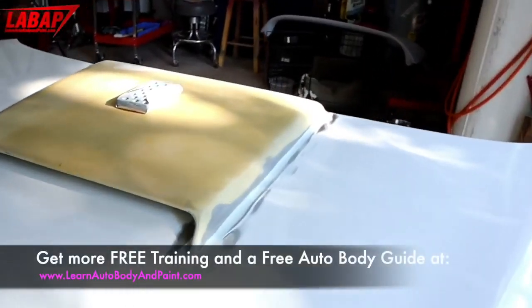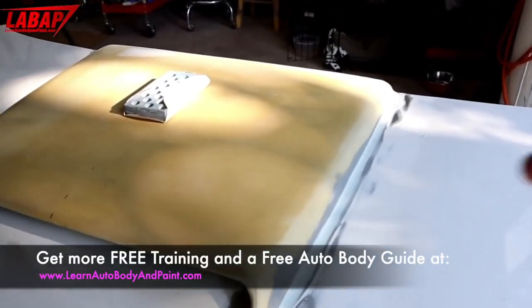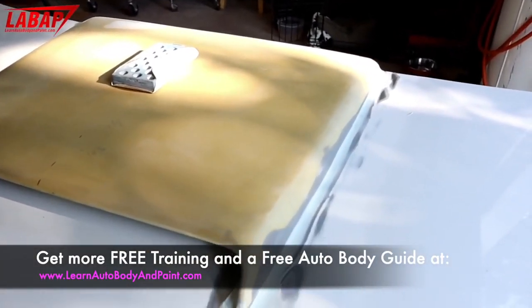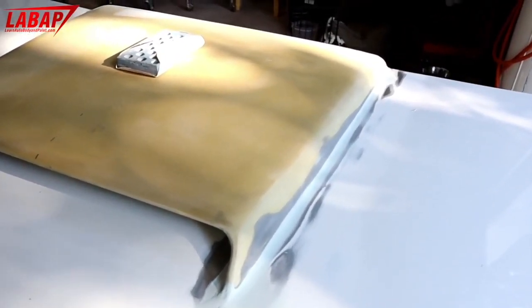Now, when doing custom work like this, you're going to go over with Bondo at least 4 passes, sometimes 6, sometimes up to 8 passes, because you're trying to get the shape right.